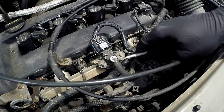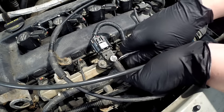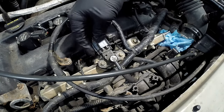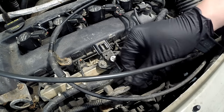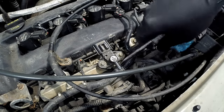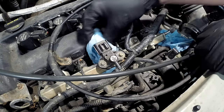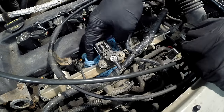On a cool engine, we're going to pull the vacuum line off using a pick so we can move it off without splitting anything, because these lines get really brittle after a while from the heat under the hood. Then we're going to disconnect the electrical connector. It's not totally necessary to disconnect the negative battery terminal, but it is a good idea. Pull any harnesses out of the way so you don't pinch them, then place rags or paper towels underneath — there's going to be some fuel spillage either way.